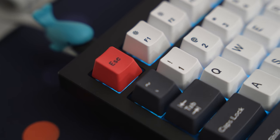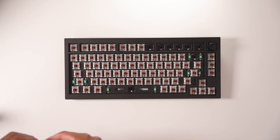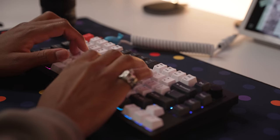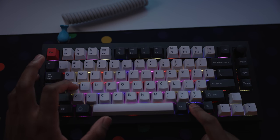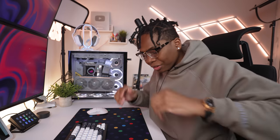So if you currently own the normal Keychron Q1 keyboard and you're wondering what's the major difference — is it just the knob? Well, not actually. Keychron did a few incremental upgrades to give a better performance and overall experience while typing. Yes, they added the knob. Secondly, the knob version uses Gateron G Pro switches instead of Phantom switches, which gives a better typing experience and sound. This time around, it's a steel plate instead of an aluminum plate, making the board heavier and sturdier. And whenever you're typing, there's no real flex — that's because of the double gasket system used on the top and bottom of the board, which removes ping and all that good stuff.